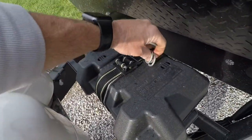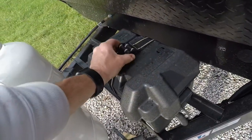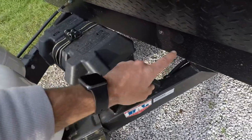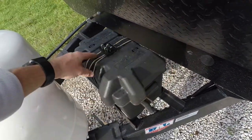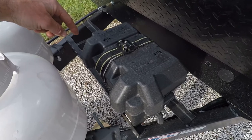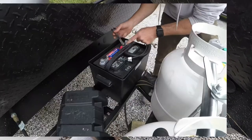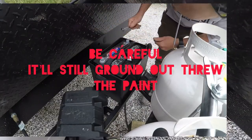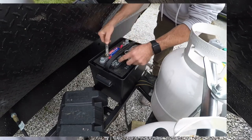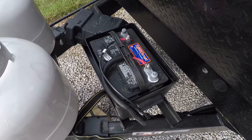You can see here this is about your standard setup on travel trailers, and we are going to be alleviating this. We're going to be pulling these wires back into the camper and hooking up to our Battle Born batteries so we can charge off our new converter. This is basically the house battery that comes on it — it's a heavy-duty battery but it just doesn't last through the night running the furnace. So I'm going to throw these leads in to charge the Battle Born batteries off the 30 amp Progressive Dynamics lithium profile charger.